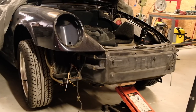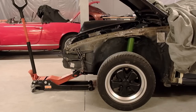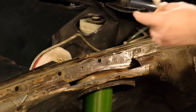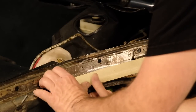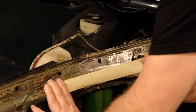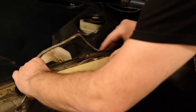It is astonishing how well these late G models were protected against rust. All panels are galvanized and covered by some beige-gray paint, which I often find entirely fresh and unharmed — like here inside the suspension turret. The wheels had been off the ground during the entire repair to as much as possible avoid welding the new panel into a deformed chassis. The bending moment of course still has to be supported by the structure, but at least it distributes over the entire sidewall.